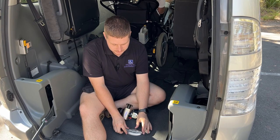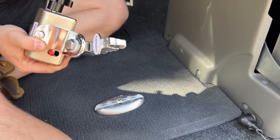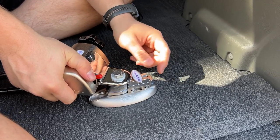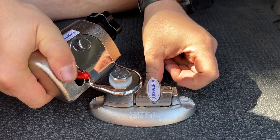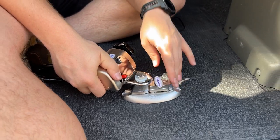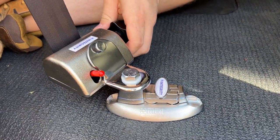These are really easy to use. The way they work is — as if this is bolted to the car — we've got the restraint top mount here. This is a removable part which allows you to bring the wheelchair in and out of the vehicle. You press it down like so, this little bit with our Integrity logo will flip up here, and then we push it to the slide and we can just see it lock into place. Once that falls down into its correct spot, that makes it all locked down and ready to go. Once that's in its position we can use this red lever to unhook the tie-down hook and use this spindle to tighten it up onto the wheelchair.